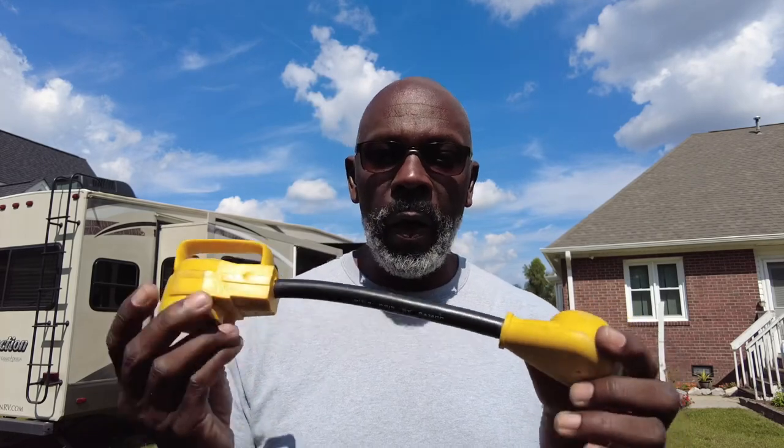I know you already have questions. If you don't have power at home, that's as simple as working out even the 20 amp situation. You can use what they call a dog bone. On one end this fits into a regular socket, and this end fits 30 amp service. I have 50 amp so I have another one that reduces from 50 to 30. You can plug this into a wall socket at your house, run it to your camper, charge the battery, open the slides, and turn the lights on.